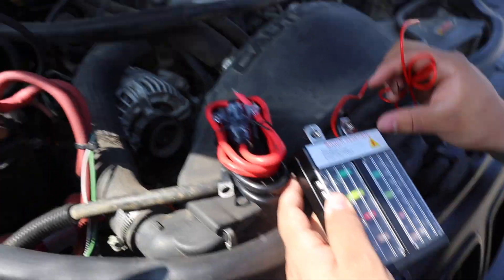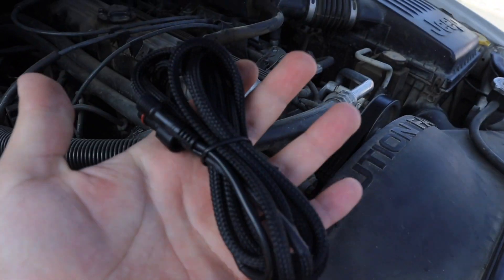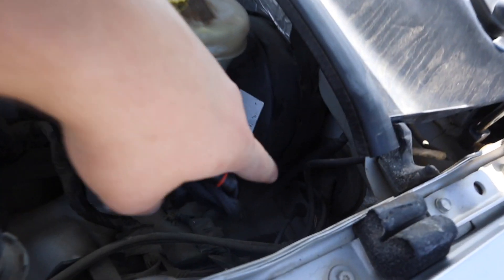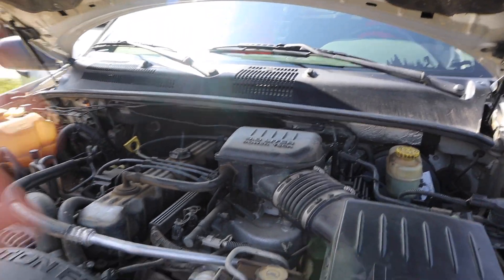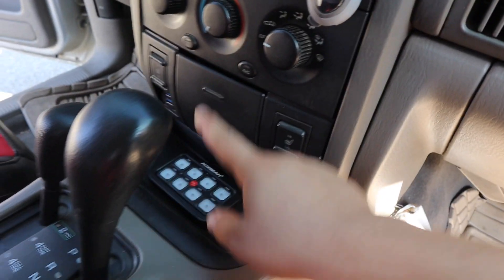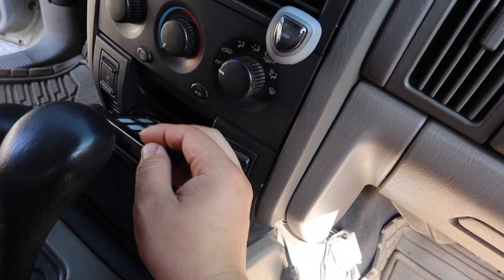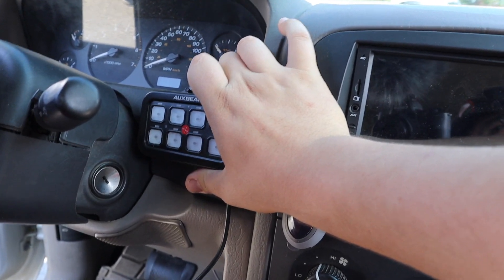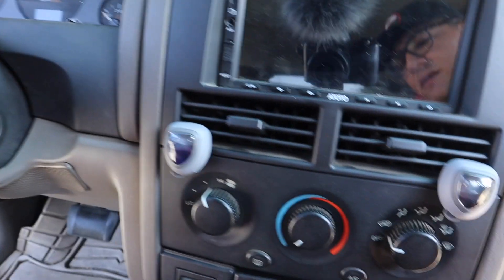The main things you have are the fuse box, which goes in the engine bay, the cables that connect to the battery, and the signal wire that goes to your switches. I'm going to mark things up to find the best way to get into the car. On the driver's side there's a rubber grommet we can go through — that's our best bet. On the inside, I think I'm going to put the switch panel in the ashtray area and modify it so it opens and closes but stays hidden when closed.